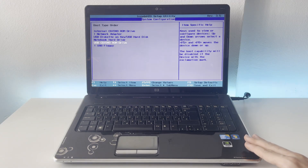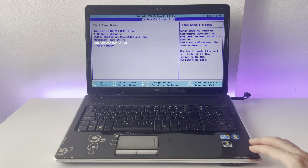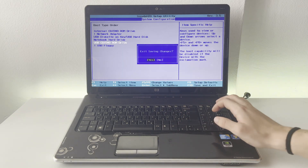I'm not sure if this laptop already has an SSD, but I definitely recommend spending $20 on a new 128GB SSD because that amount of storage is perfectly fine for retro gaming — you don't need more — and it will significantly speed up any computer you have. So definitely upgrade the SSD if you can. I'll press F10 to save and exit, and now it should boot from the CD drive — and it is. We can press any key to boot from the DVD.